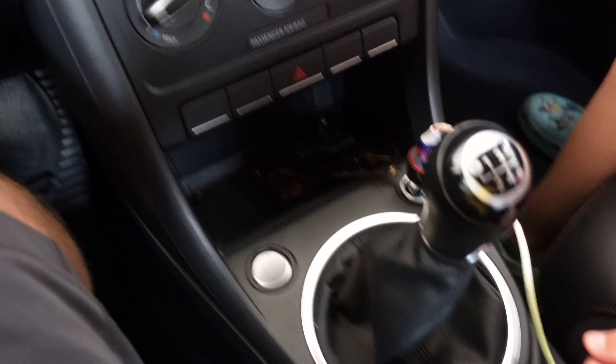Time for the final step — let's go change that pesky little oil light inside the car. We're going to reset the oil maintenance light. What you're going to want to do is push in the SET button while pushing the start button. Hold in SET and push the start button. You'll get a little reading: 'Do you really want to reset oil change service?' Use your little pad and select OK. Push it in once and we're done — that is it.